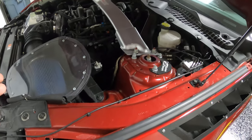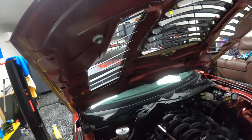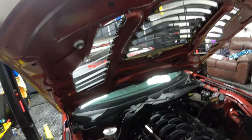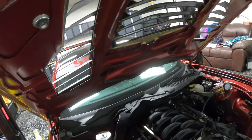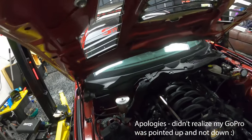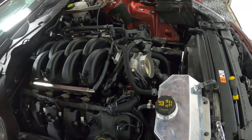After the spark plugs, we'll do a compression test, then a leak down test. To do the compression test, you want to pull fuses 48 and 49 for the fuel pumps. Then pull relay number 81 — it's at the front, down to the right. You can take a jumper and jump the two first contacts, and it'll turn the motor over without needing to use the key or turn any other part of the car on.